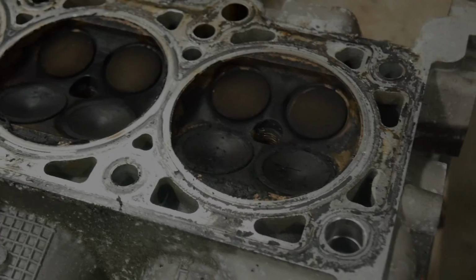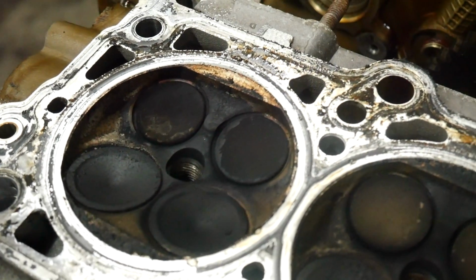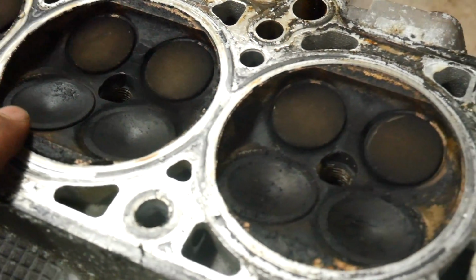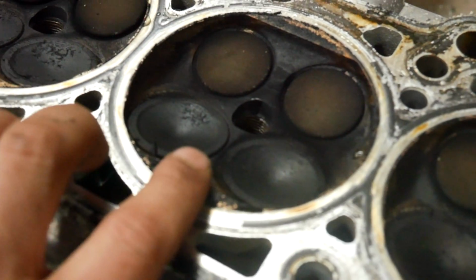That is amazing. So here is the driver's side cylinder head. It actually looks pretty good. This is what I'm talking about. These are the 9-thread cylinder heads, and you can tell by the casting number. I'll show you what the casting number is here in a second. But this is the whole reason I try to go for these engines.